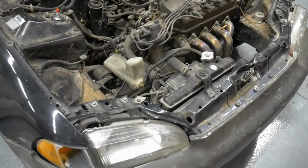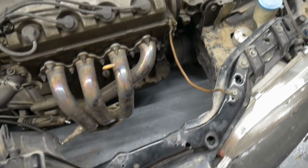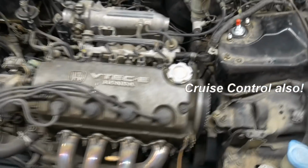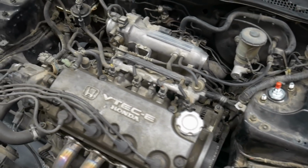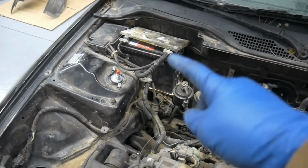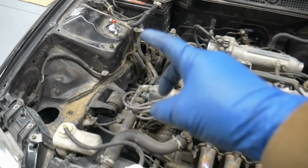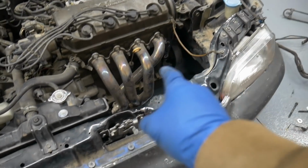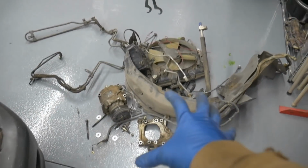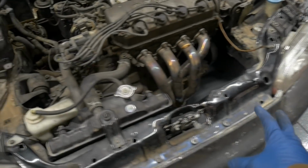And that is where we finished off for today, guys. We ended up removing all of the AC and power steering lines. It still has the power steering rack. He's gonna go to a manual one eventually, just not yet. And all the AC lines up to the firewall were removed. We'll remove the evaporator core eventually. But we took out the condenser, compressor. We have all those parts here. I'm sure they weigh a significant amount. We're gonna actually try to weigh it really quickly and see what kind of weight that was at.